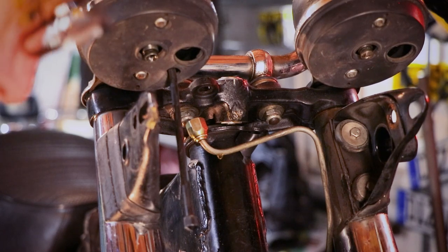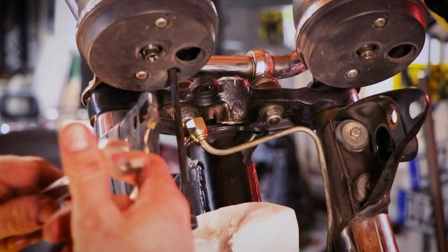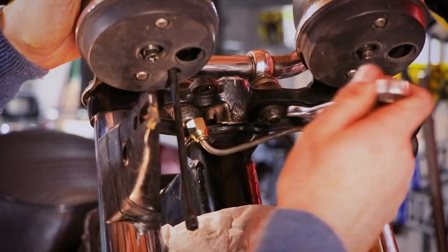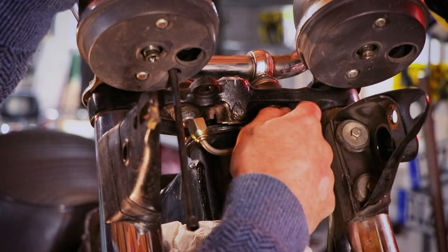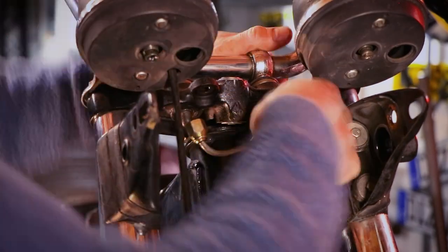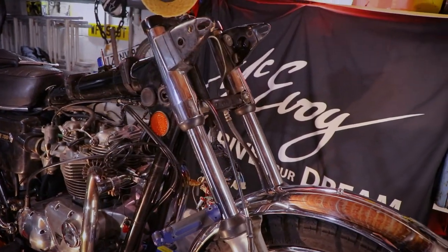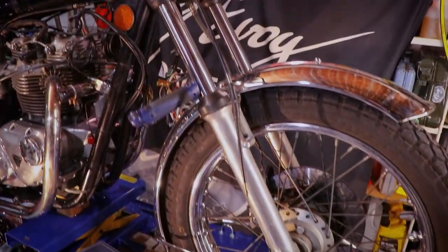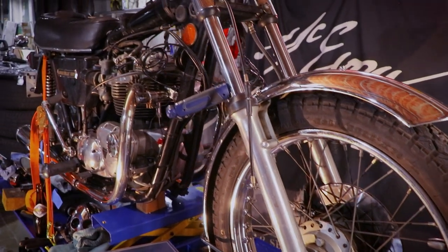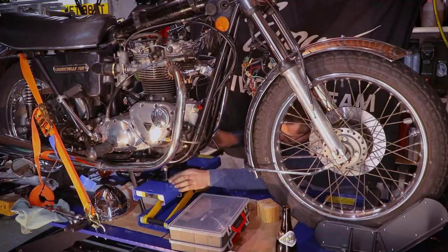Right, so we are sticking with the 9/16 spanner, which enables us to remove the 2 nuts, which were frighteningly loose, of the handlebar. Let's try not to punch myself in the face. There we go. Everything has been taken off the front, so now we have to concentrate on getting the wheel off the mudguard, and then we can finally take the fork off the bike and apart.